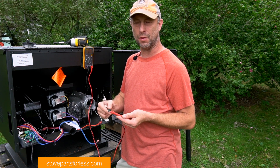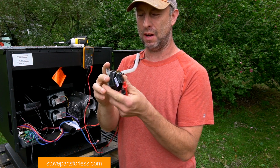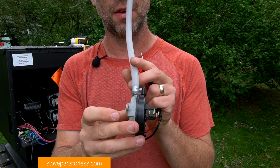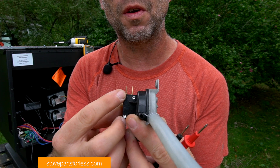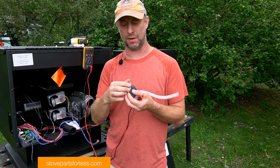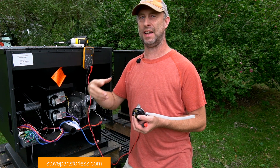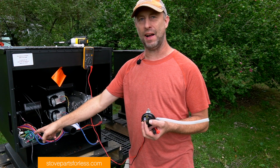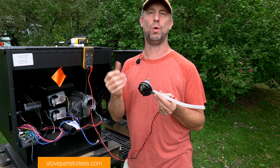I can show you how to check that. Here is our vacuum switch — you'll see that there are three pins: one, two, three. The first lower one is the common, so a wire is always going to go on there. The switch has two sides: a gray side which is normally closed, and a black side which is normally open. On this stove it's always going to be looking for negative pressure on the normally open side. The combustion motor turning on creates airflow, which creates suction and closes the switch. When we lose suction, we lose contact and that's the error code you're getting on the board.